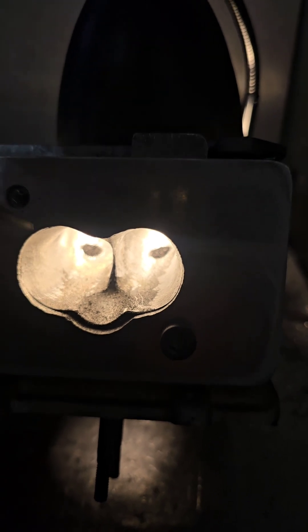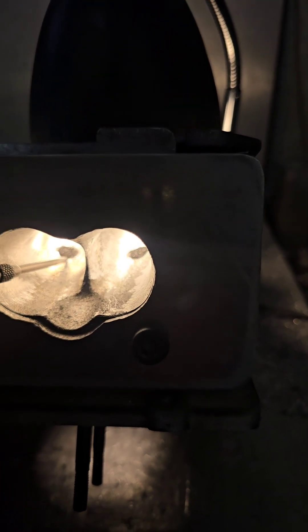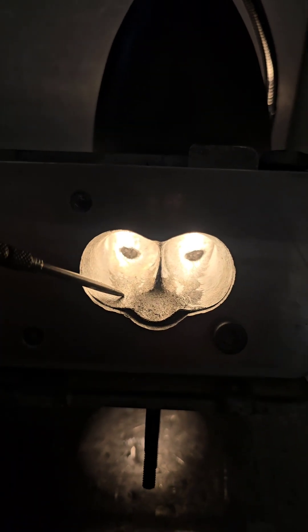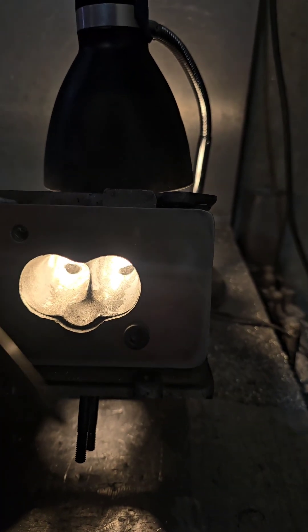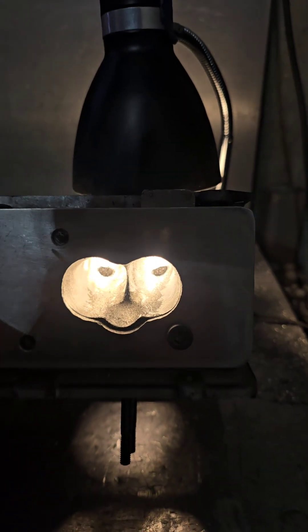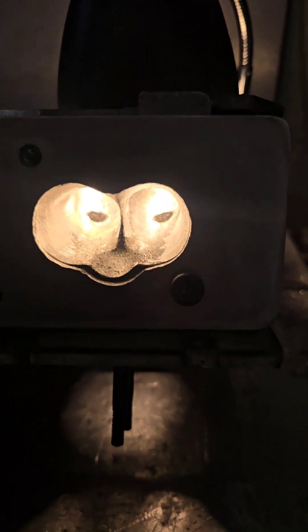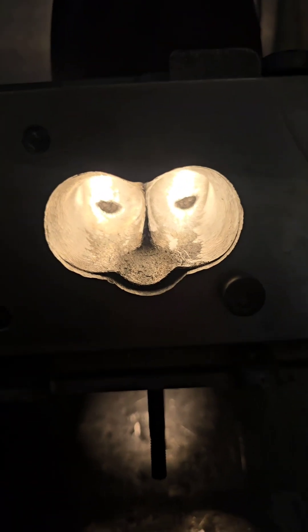This transitional period that I talk about is so important. If we understand Newton's first law of motion — even though this is not a still object, we're going to put more energy into movement. Because we're accelerating it, all of a sudden we're going to get density thinning in that air, and it's actually going to reduce the molecular mass — how many molecules we get in that cylinder. You've got to remember this is a timed event, so this is why the velocity gradient is so important in the primary induction length. It should be stable all the way from the bell mouth all the way down to the valve seat. The more stable and the more it slowly, slowly speeds up to the valve seat, the more horsepower, the more mass we get into the cylinder, and the more we improve the volumetric efficiency — especially if the CSA targets match our RPM and cubic capacity. That's when the magic really happens.